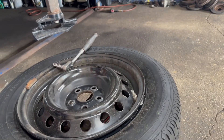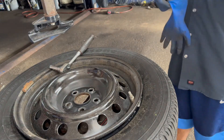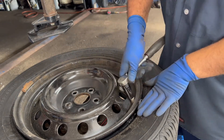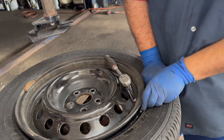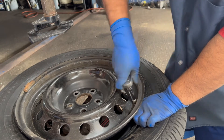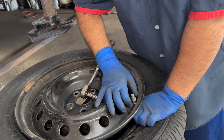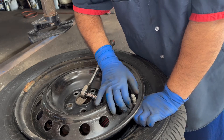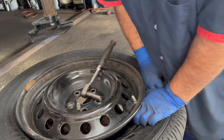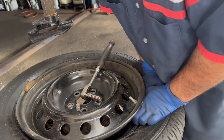I've broken the bead on this wheel. It's very simple — grab an 11-millimeter, go from the bottom, and make sure you don't drop it in there. Remove the sensor — sometimes these valves can get jammed, so you may have difficulty getting it off. We got this one off, and we don't want to drop the sensor below, so be careful.